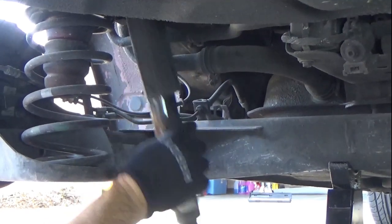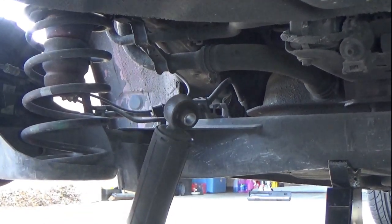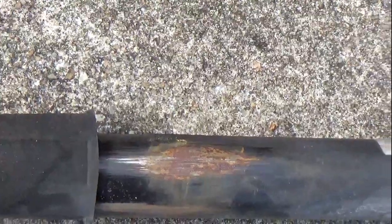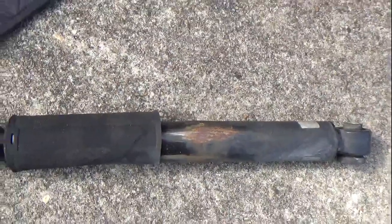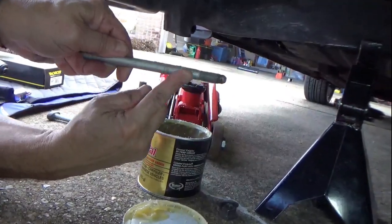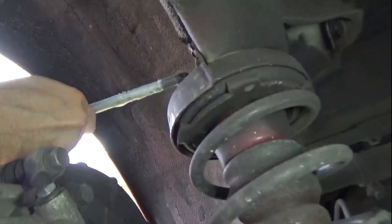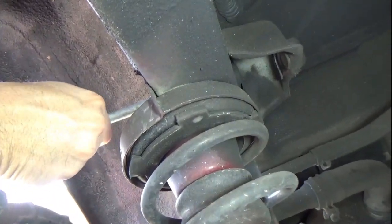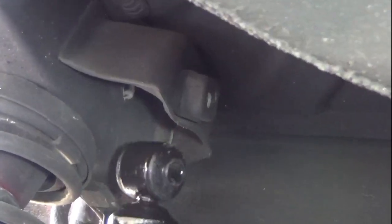This strut was sticking because it had been leaking fluid. In addition, you can see where it was rubbing against the boot. These shocks had about 90,000 miles on them, so they were due for replacement anyways. As noted earlier, these bolts have unique designs, so coat them with anti-seize or grease to prevent the threads from getting damaged during installation. If you damage one of the bolts and need to replace it, you will likely have to wait a few days because AutoZone probably won't have these on the shelf.